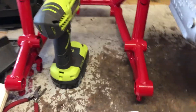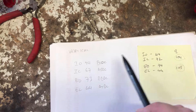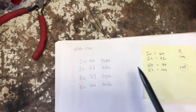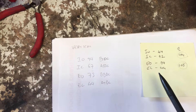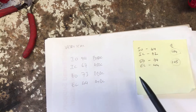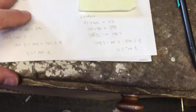Let's just check that against the datum set. Where I'm at at the moment: inlet opening is the same, inlet closing is five degrees different — 73 and 44 — so I'm one degree out on exhaust opening and bang-on on exhaust closing. Let's just work out those theoretical center lines again.